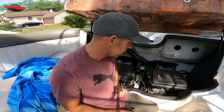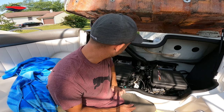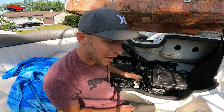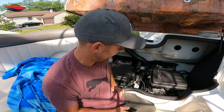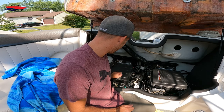Now that the water's draining out, the last step before I wipe everything down is I'm going to fire these motors up — I'll do them one at a time. I'm going to let them heat up and evaporate all the water that might be in little crevices. The engine is going to shake and rattle a little bit, which will vibrate out any trapped water. These engines are weather-packed from the factory — it is a boat engine — so we'll fire it up, get them warmed up, and then show you the last step.